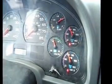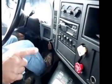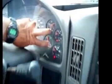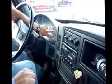I'm going to pump my brakes down. I'm going to get both my valves to pop out. That's going to happen between 20 and 45 psi. Now watch your valves. They may come out at different times. They both came out, and they came out roughly at about 35 psi. You got to point at the gauges. Okay. At this point, this completes your in cab.